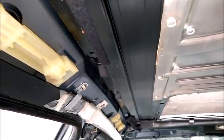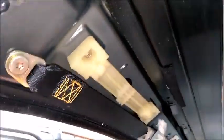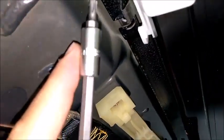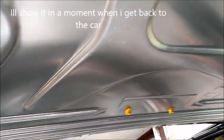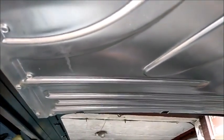Another thing, you have a lot of screws and you need somebody to help you remove the cassette because it's very heavy. So instead of removing all on one side, do it as when you change the tire bolts. Leave one screw at each end, and before you remove the last screws, you need somebody to hold the cassette so you can drop it safely.